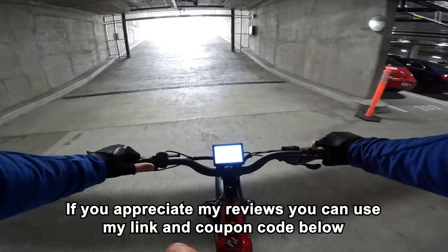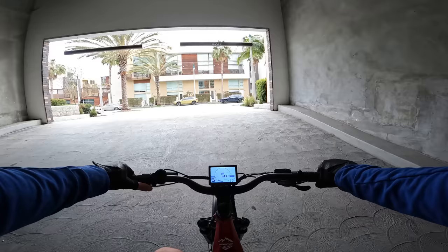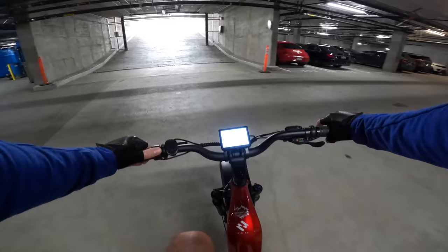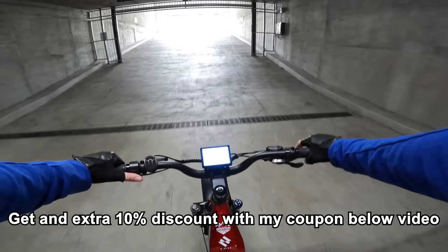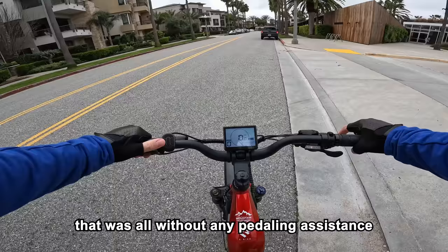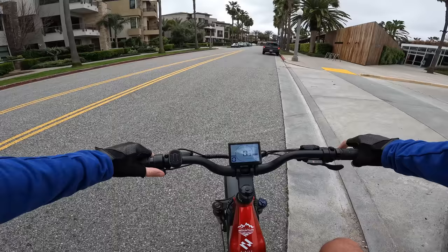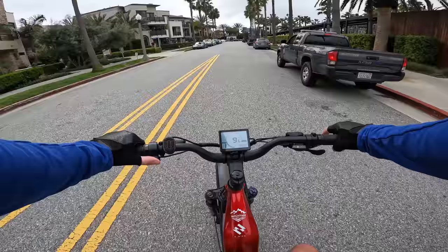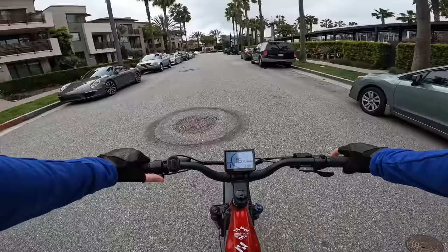With a rolling start at about 4-5 mph, it hits 800 then drops through 700, 600, 500, 400 watts — so not the greatest hill climber from a slow roll. On a second attempt rolling in at about 5 mph full throttle, it gives us 900 watts sustained, then 900, 900, 800, 700 watts. With a proper rollout it can make it up the hill just fine. It looks like it will give up to 900 watts even on pedal assist 1 and bring you up to about 20 mph under throttle only.